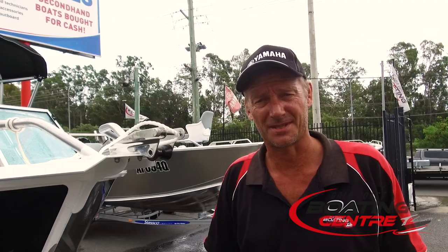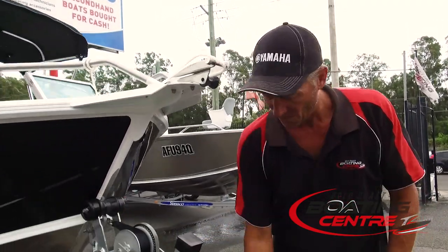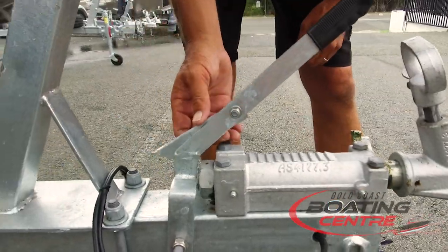It's important you follow a few basic steps when you're towing. When you're towing your vehicle in the forward direction, always have the yoke open on the braking mechanism, and always have your handbrake off and the lever flipped to the back.